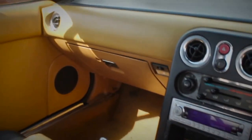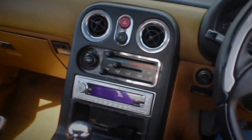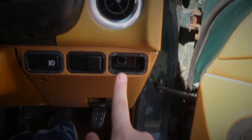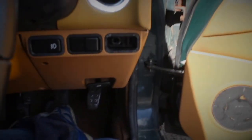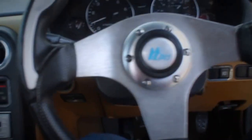So with regards to the car itself, for those of you who have never seen the inside of a Eunos — which is pretty much like myself — there's not much in the way of switchgear. On this side there are three buttons: a fog light one here for the rear and then two blanks. This one here I think originally had the front fog lamps in it because I can't find a switch to turn them on — there might be some wiring buried in the back of there. Unfortunately at the moment the horn doesn't work, so that'll need to be addressed before the MOT as well.